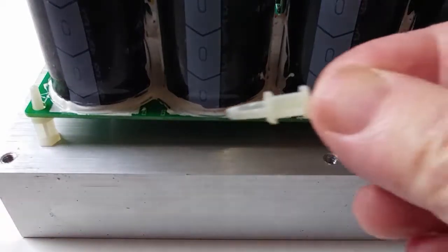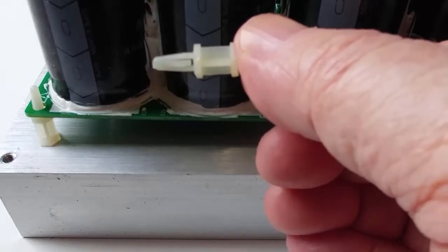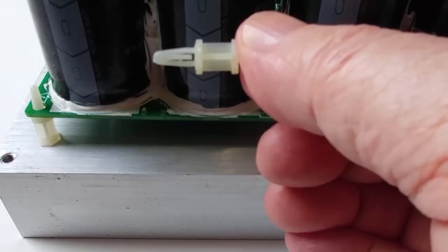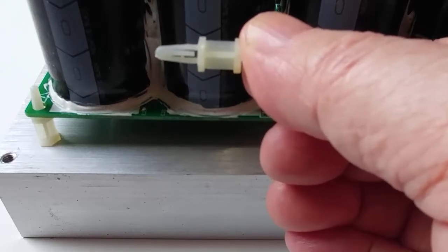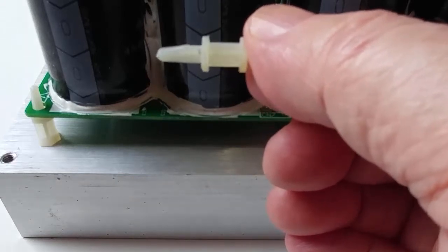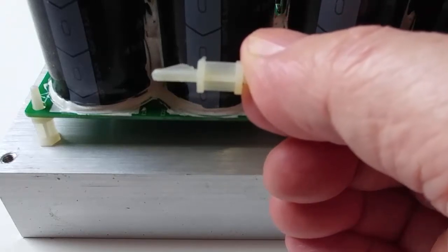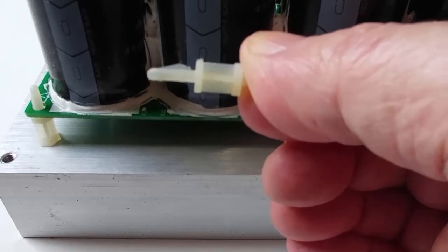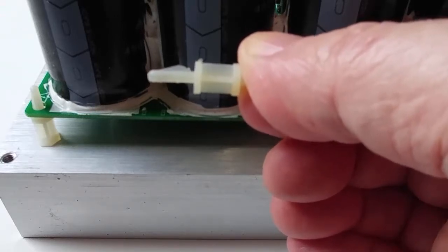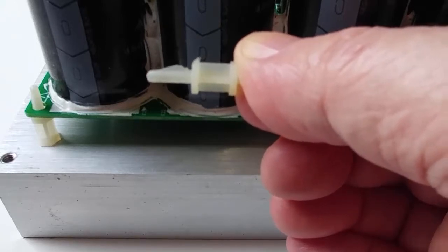Let's take a closer look at one of these. On the side profile, there's a little part that's a barb, like a fish hook. I'll rotate this 90 degrees and you can see the profile of the barb and how it sticks out, creating a gap that makes pulling the circuit board off very, very difficult.